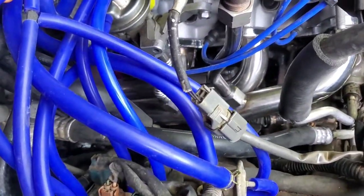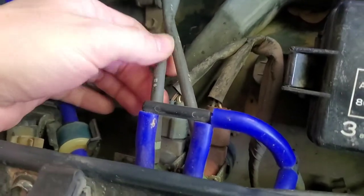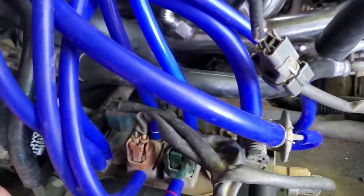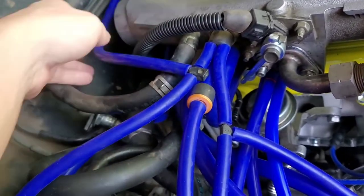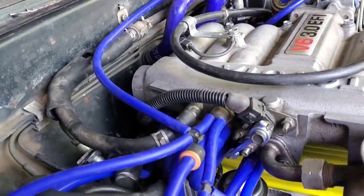All very important — you've got to have all these going to the right spot. I'm slowly replacing some of these other things; I haven't replaced this one because I believe it's just a bleed-off line for unmetered air that goes down and literally sits at the bottom of the engine. You also have a check valve here — I'm not sure exactly what this one does, which is why I saved it for last. It comes off that little split, follows back around to your last open nipple, and that one also splits off and goes to your brakes because the brakes rely on a little vacuum too for this truck.